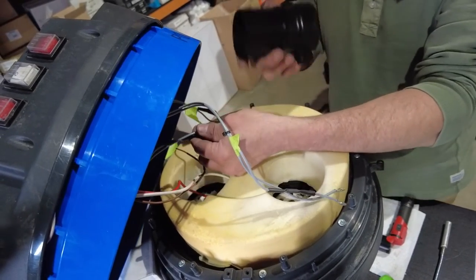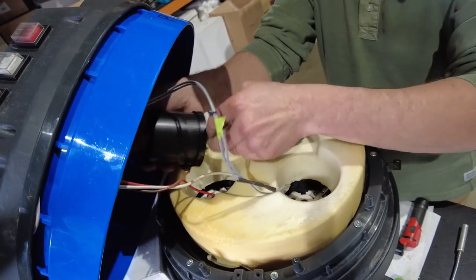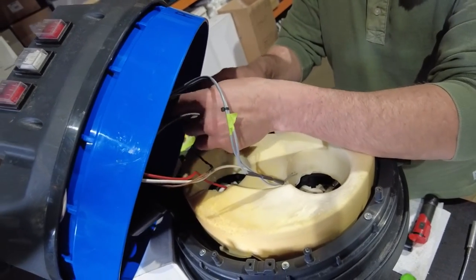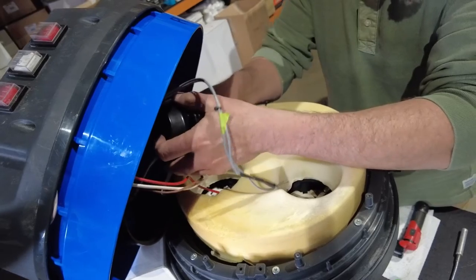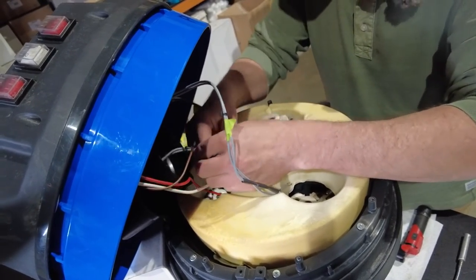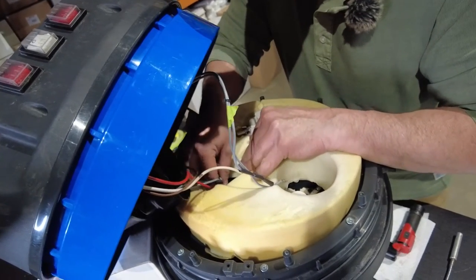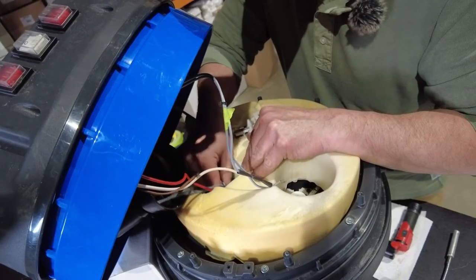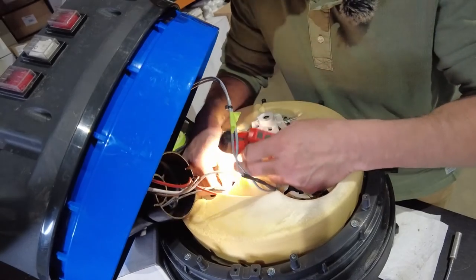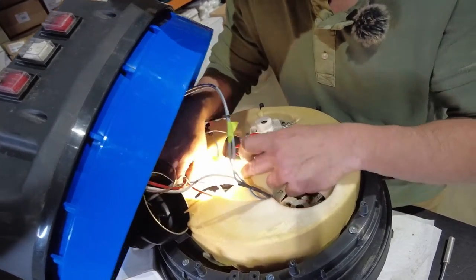through the cap assembly. So there's two caps for air duct shrouds. First one, the second one. And we'll just clip them onto the motor. So the little spade bits, as I said before, they will go on, and they'll be positively engaged, and we can give them a little wriggle to make sure that they're not going to come off.